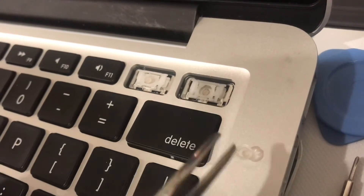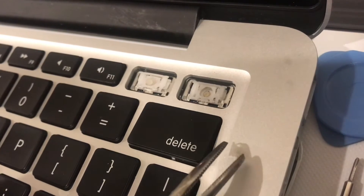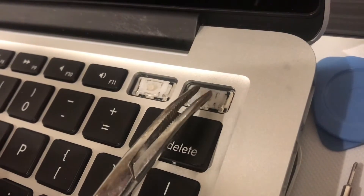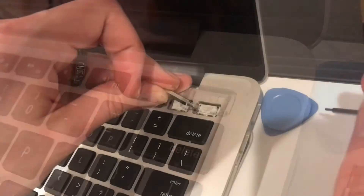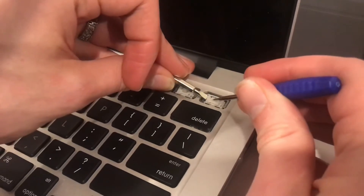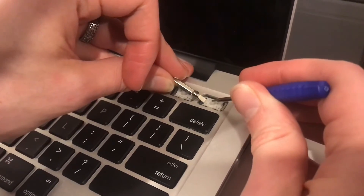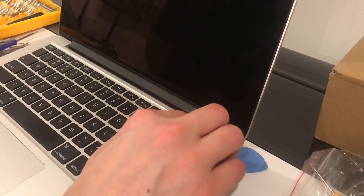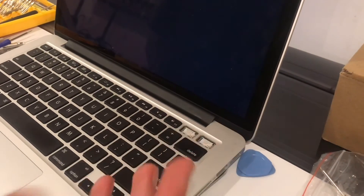But if that pad is dirty, then it won't conduct and you won't power on. So we just had to clean that pad, put the plunger back on, and now when we push the plunger, we'll get power. To put the plunger back in, I'm just going to lift up on the little key assembly here and insert that underneath there. Now when we push it — voila!